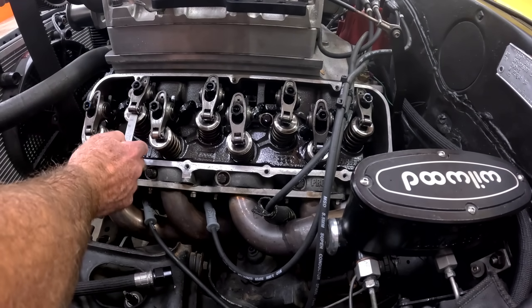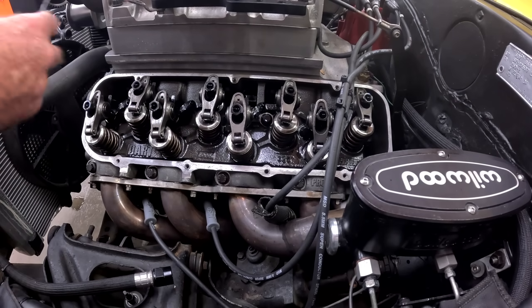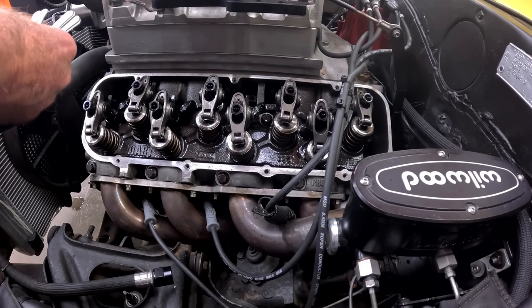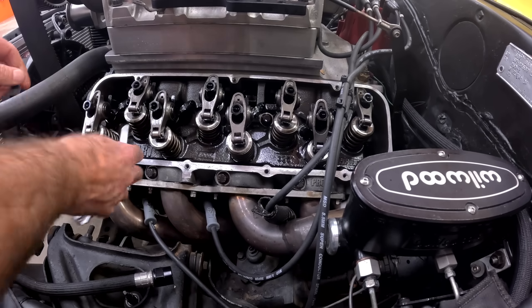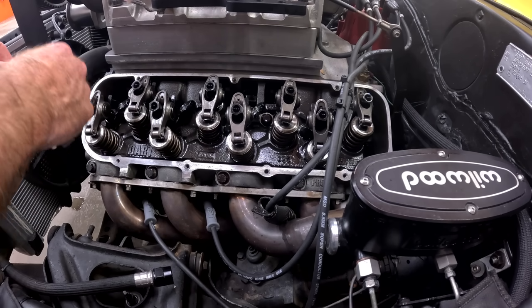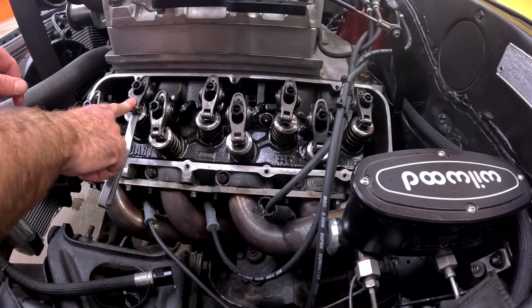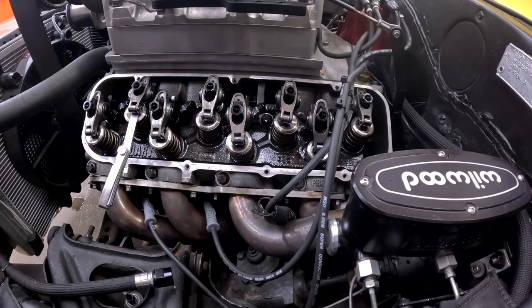And the intake is a little looser. It's probably closer to 25 than 24. Let's see here. Yeah, there we go. It goes in there. So 24/1000 there, 25/1000 there. Let me write it down.